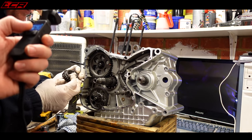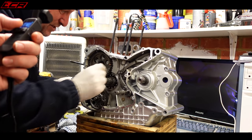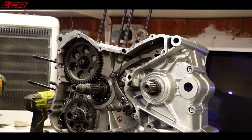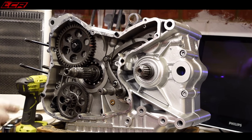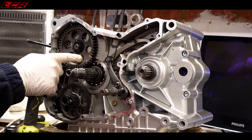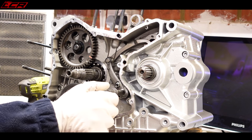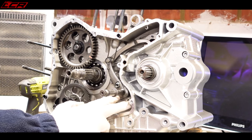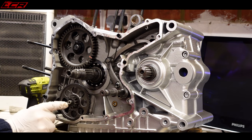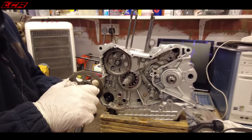That just pops off. There's another key in the shaft there. What's left now is the intermediate timing shaft drive gear — just another tab washer — and a gear selector fork held on by two bolts, then the starter wheel which is bolted. It's evidently a slightly later engine; normally you have a boss with two cutouts and a circlip to hold the wheel in, but this one is bolted.